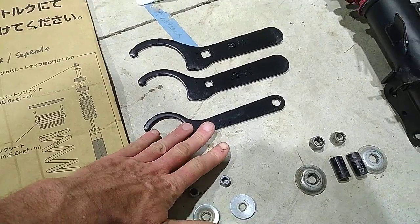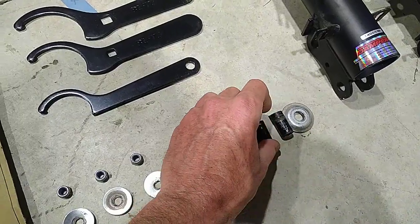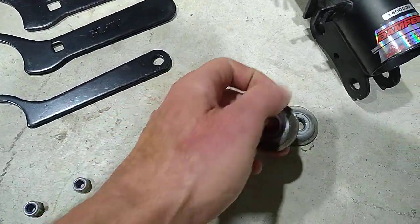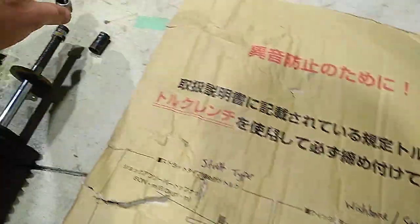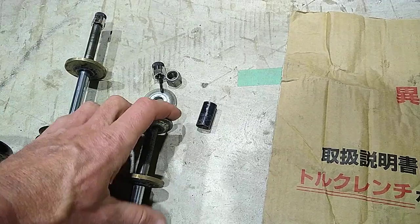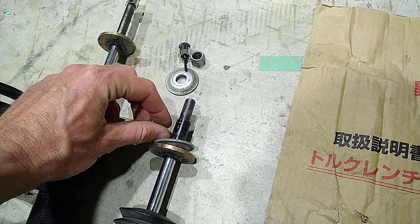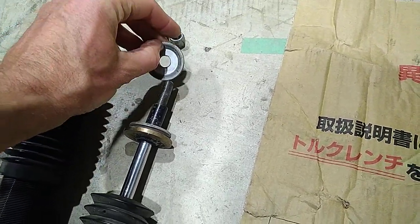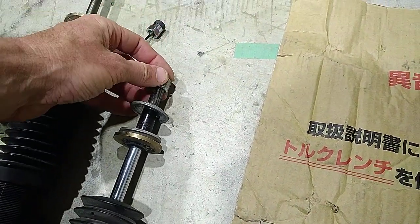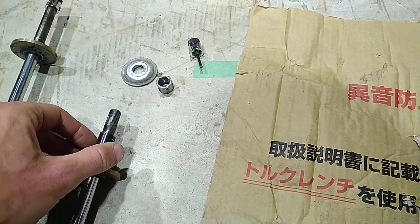You've got your C-spanners so you can adjust it all up. These brackets go on the rear struts — here. You need two per side and a nut. You take the top off, put one of these on, then put that on with the rubber donuts that come out of the original suspension, put another one on top, and that's where the car body shell goes through. Bolt it down, put that on, and put that through. So that's your hardware for the back.